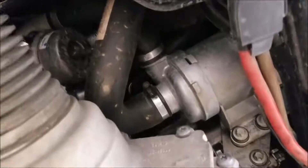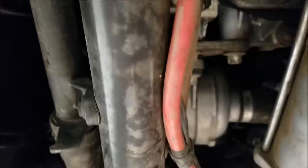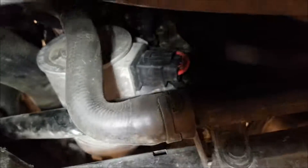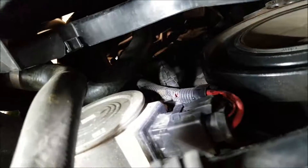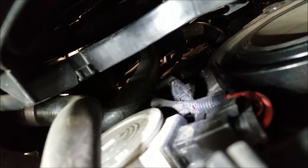The other thing that surprised me was the thermostat seems to be mounted directly above the water pump on this car. My understanding was that the thermostat was kind of off to the right of the water pump, but on this car it's directly above. So I'm going to do the electrical connection first — take off that main water pump plug. There's a clip you can see above, mounted to the engine. It holds that wiring loom, so you've got to pull the wiring out of that organizer clip before you can get the plug off.